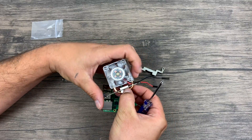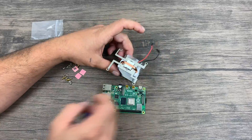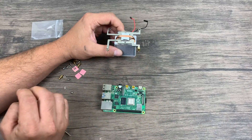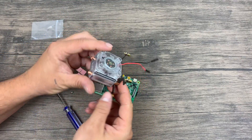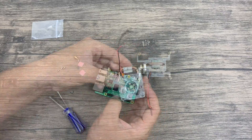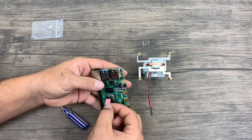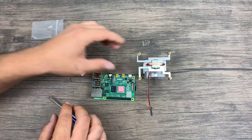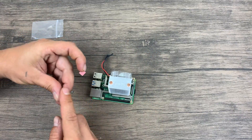On the heat block, there's a hole in each side where the mounting bracket is going to mount with a small screw. Make sure you don't over tighten these — you really don't want to strip out this aluminum. The kit also comes with brass standoffs. We're going to place them in the mounting brackets on all four corners. They're going to mount right up with the holes on the Raspberry Pi and sit above everything. After you have the brackets and standoffs assembled on the heatsink, just make sure everything lines up, and you really want this fan facing towards the HDMI side. Now it's time to apply the thermal pad or thermal paste, whatever you choose to use. I've always had really good luck with these little pink pads, so I'm glad they included these instead of the old tissue paper style. Once we have the thermal pad in place, it's time to mount the heatsink to the Raspberry Pi. Make sure everything lines up, and we're going to be inserting four screws from the bottom of the Pi through all the mounting holes to the brackets on the heatsink.